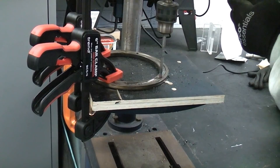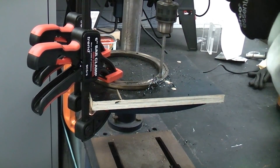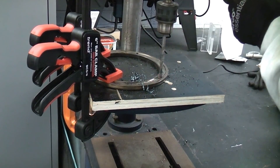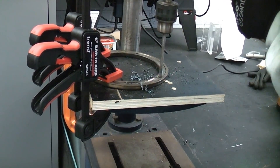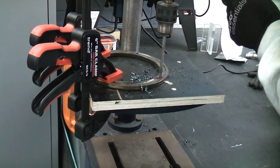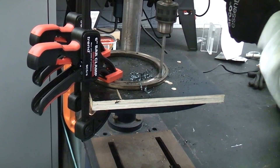These drill bits can actually be used to drill through a steel bearing race, which is one of the toughest steels you can get. You do have to use these drill bits at a very high speed. For that reason you need to use them in either a mag base drill or a pillar drill when you are drilling steels.